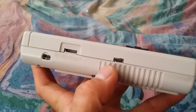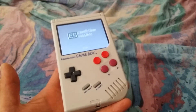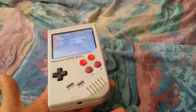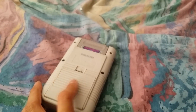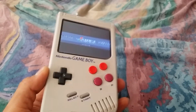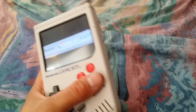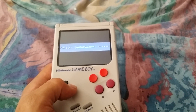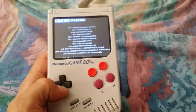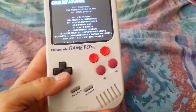It has HDMI, direct power USB, and charge. I also measured that everything on this while playing games draws about one amp exactly from the battery. It has a 2000 to 2100mAh battery in there, so I get exactly about two hours out of this — it spikes up to about 1.1 amps sometimes, but most of the time it sits around 900-something milliamps. I also turned up the gain, so it has really loud volume.